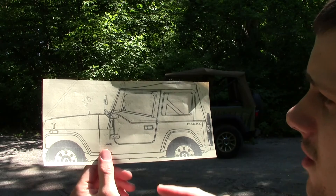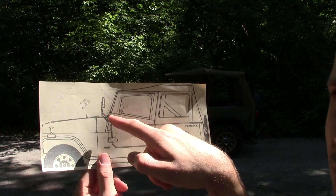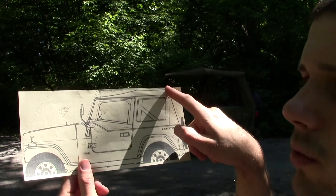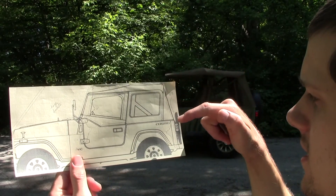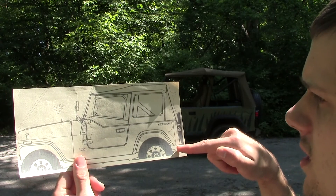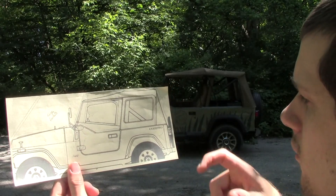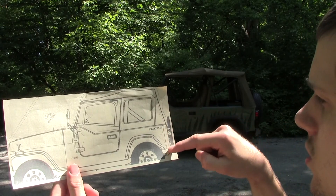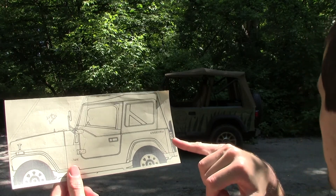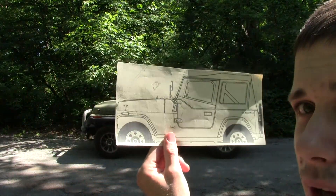What I need to do is make a support that rides along the hinge on the top for the windshield, bends a little bit, rides along that angle, and goes up to my roof rack which I also need to make. It then extends down on this side and either anchors to the frame or down to the body wall with bolts through there — the body sits on the frame with rubber bushings. I was in an accident where somebody smashed into me.